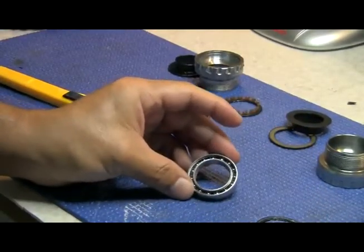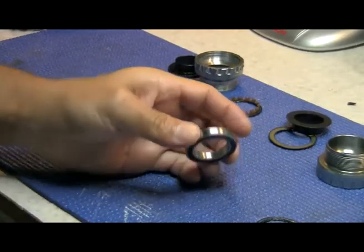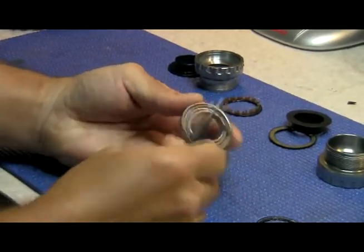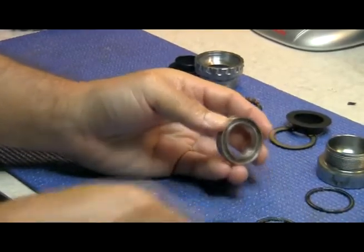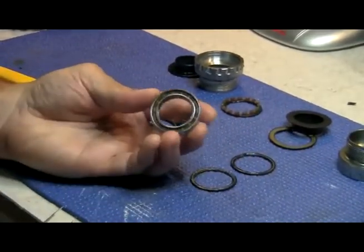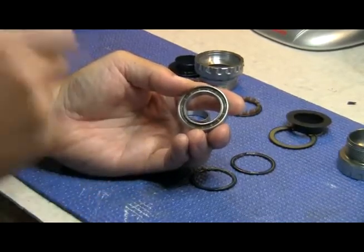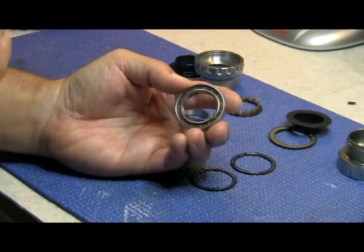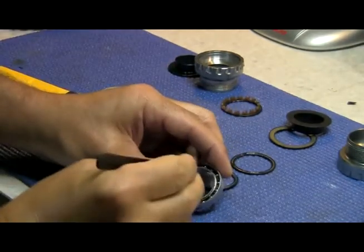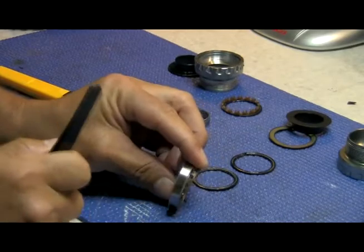Here are the bearings. We have to get rid of the bearing balls. To do that, go to the back and remove that seal — same procedure as the front seal. Go around, take it, be very gentle. On the back you'll see a plastic separator; this is what separates the balls on the races. To remove it, do not remove it from the back — that is not how you do it. You're going to do it from the other side: flip the bearing around, close the tweezers, and very gently pinch between the balls out. This is where the bearing grease sits, and it'll come right out.